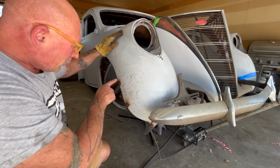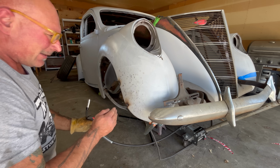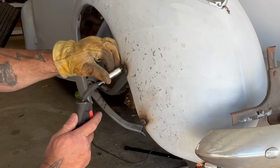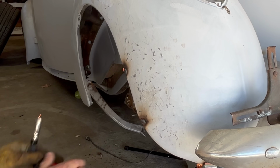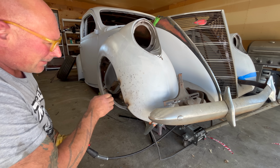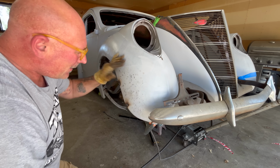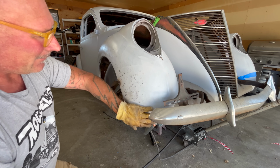All right, so I welded a good bit around that area that was damaged because it was obviously really fatigued, and that's why it cracked. So this annealed it. It's annealed the whole area around there and rigidized it. And now I can continue, just finish this off and grind that, and we're strong and flush.